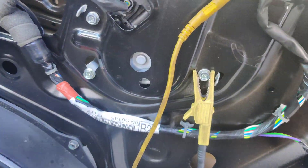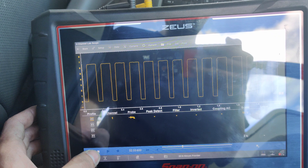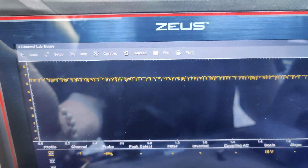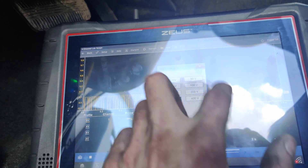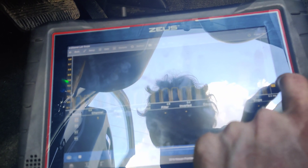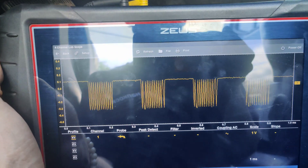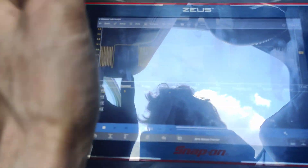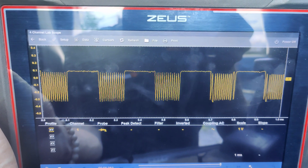I back-probed the sensor on the driver's door and I get this square wave right here. I think this is a known good - I'll show you what a known good looks like on the other side. I'm on the driver's side probing right down there. I tried both sensors and get the same waveform. If I AC couple it and lower my voltage and pick my time up a lot faster - down to one volt, five milliseconds - that's what I'm getting. Going down to one millisecond, it looks like communication. So that side's open circuit - if I unplug this, I get the same signal as the other side. I think there might be an open circuit in there, or maybe the wire's open going to the center console.